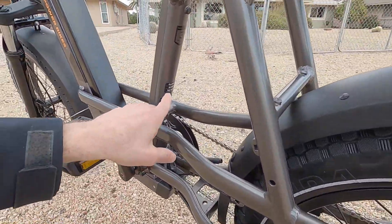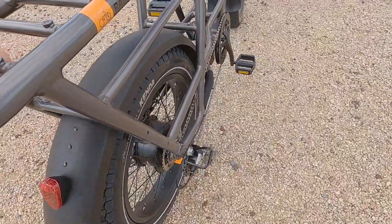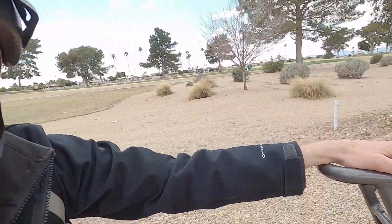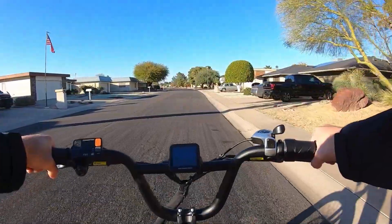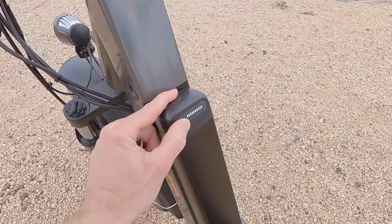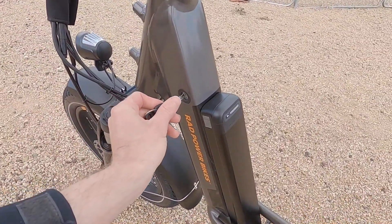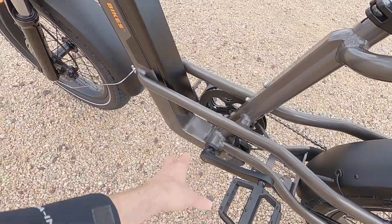This is a Class 2 electric bike with a 20 mph top speed. The motor is rated at 750 watts and 64 Newton-meters — it's a planetary geared motor, and it looks really nice in black. It does produce noticeable noise at high power and speed, which is one trade-off. Brad mentioned this motor has been updated and climbs 10% faster. The battery has a 10-bar readout giving 10% increments. The locking cylinder is positioned high on the left-hand side of the frame, away from the crank arm and moisture.